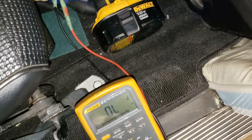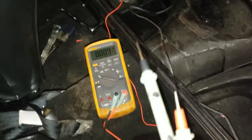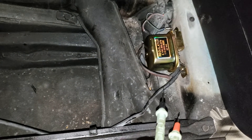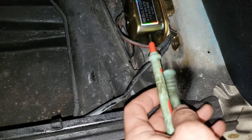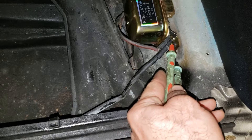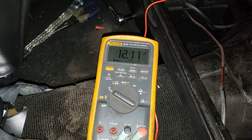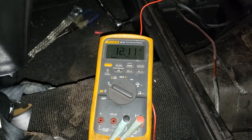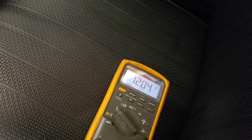I'm going to switch my voltmeter to DC volts — that's the solid line; the wavy line is AC. We could go straight to the battery but I can't reach, so I'll go from the cable leading to the battery on the positive side and body ground. All we want to know is whether the battery is charging. I've got my voltmeter with a couple of jumpers to battery positive and negative.